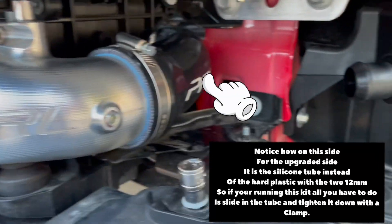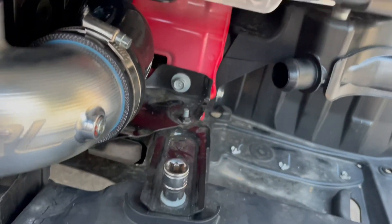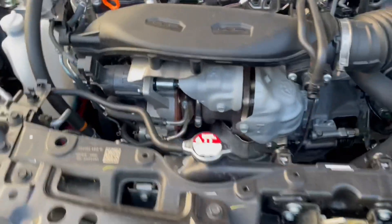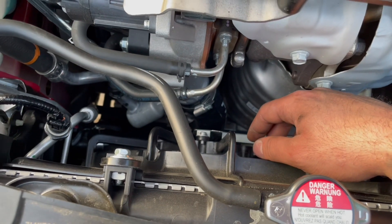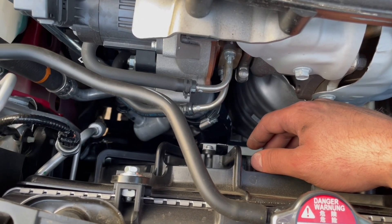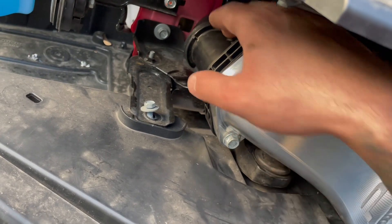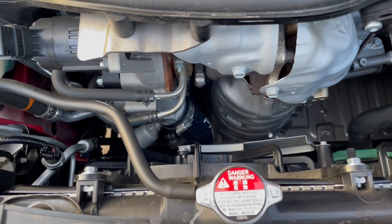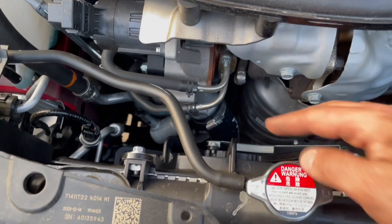Can't wait to hear this. Nothing gets connected to the old resonator piece — that's eliminated; I just left it there for now. This is practically it — it's straightforward. Remove the clamp here, that loosens everything up top, then take out the two 12 millimeter bolts, and as you saw it comes right out. Guys, it's honestly plug and play — you take off the old one and put in the new one the same way.